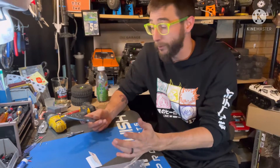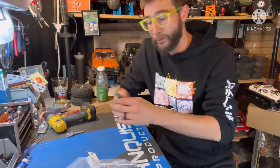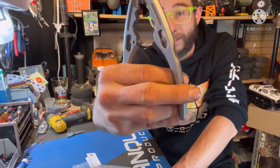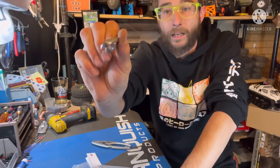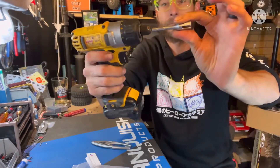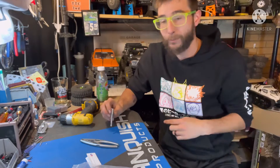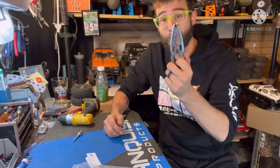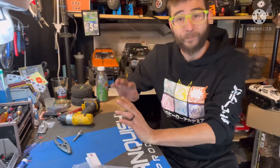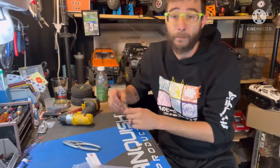Today we're going to be using a set of links from In The Works RC, ordered for an upcoming build. Before we get too far in, let's talk tools that will help you assemble links. First, link rod end pliers - these are a game changer. They make life a lot easier holding the links; soft ones so you're not scarring up the links. They hold everything and have a tool right there to put the links together or pop the pivot balls in the rod ends. Another thing I highly recommend is this rod end tool from Team Garage Hack - simple quarter-inch drive, goes right into whatever power tool of your choice. Both are relatively cheap. I always have Team Garage Hack linked down below in the description. Link pliers can range - this is simply a cheap pair from Amazon, about eight bucks. Lots of companies make them, pick whichever fits your budget. These two tools will make link assembly immensely easier.